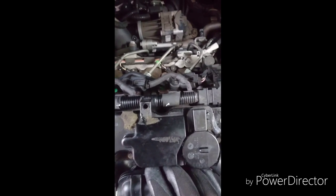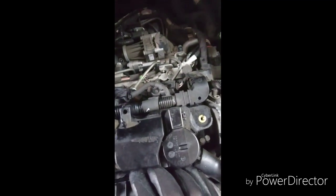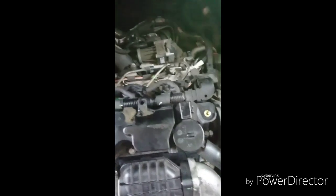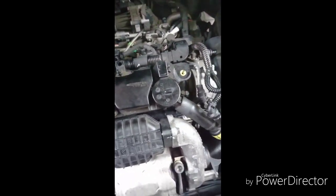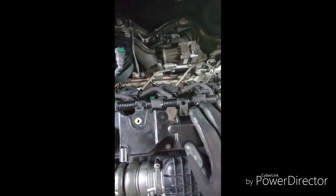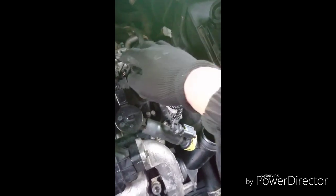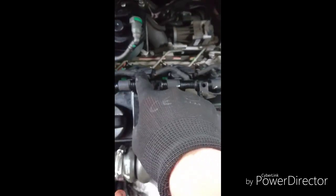When I first looked at it, I was using Torque — a diagnostic application for your phone that tells you the engine codes. I was getting an engine high resistance fault on injector 2. On the DS3 I automatically thought it would be this injector here, counting 1, 2, 3, 4. But it's actually not — it's this one. They always count the cylinders from the gearbox end. So number 2 is this one here. It's just worth noting that — then 3 is there and 4 is there.